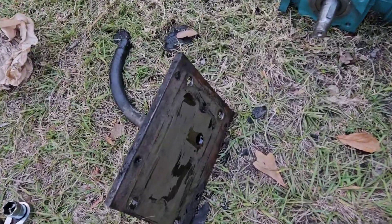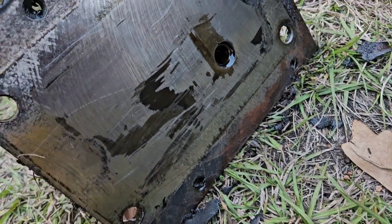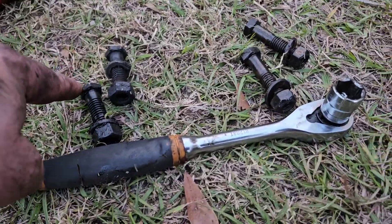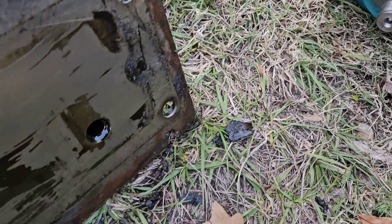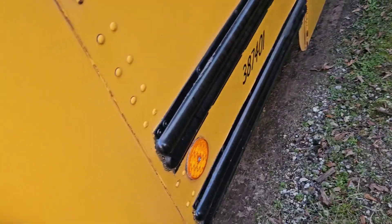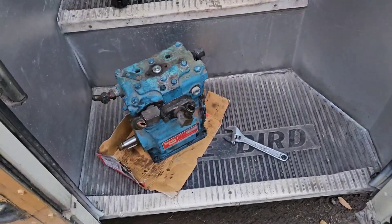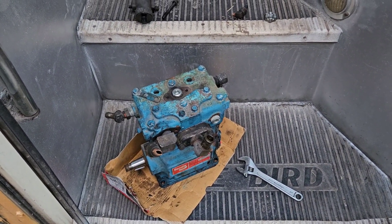I just got the platform out. As you can see, these holes right here go for the tensioners, and these four holes here are your mounting brackets. There's our bolts — notice these thin head ones here. They go right in these inset ones in the front. I've cleaned it all off. I pulled this off this time with the puller — three jaw puller. Now installation is in reverse. I've got a new base gasket and this is all ready to go. I just need to put the pulley back on and then we'll go from there.